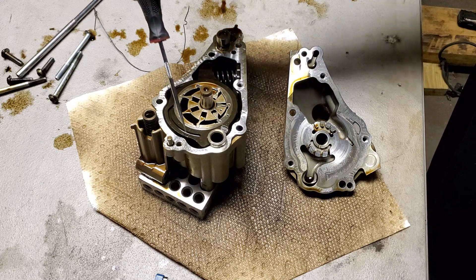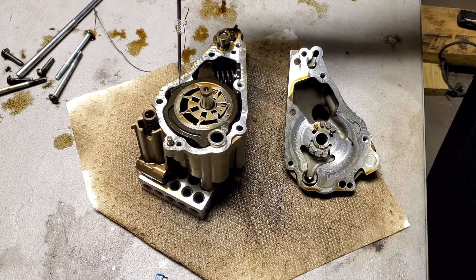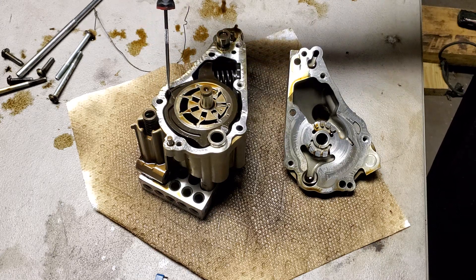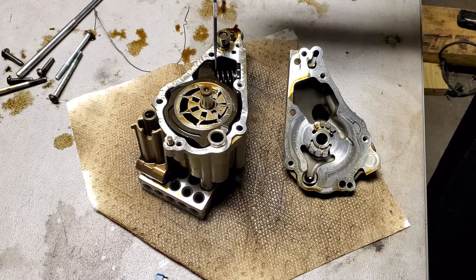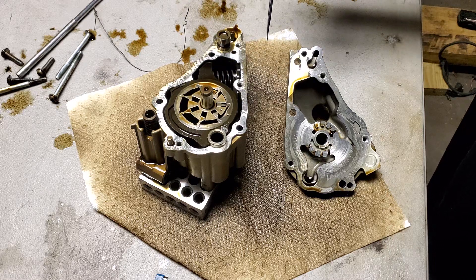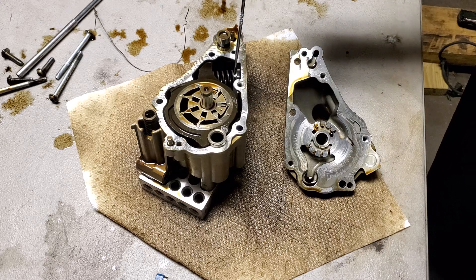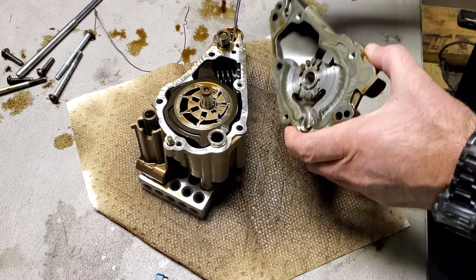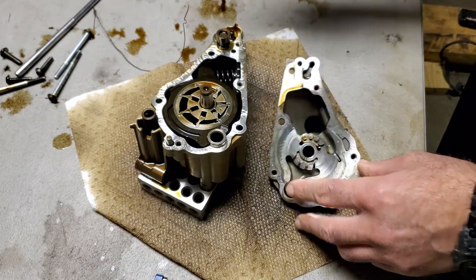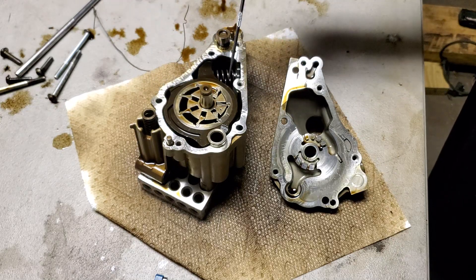However, there's an area over here which is sealed off — there's a seal band over here. And if oil were to be pressurized inside this area, it would push this pivot down and actually reduce the flow rate of oil by making this ring more concentric with the other ring. This area here is not pressurized; it's the same volume as the oil pickup, so it's at zero pressure. So there'll be high pressure on this side of the pivot and no pressure on the other side, and it will push the pivot down.